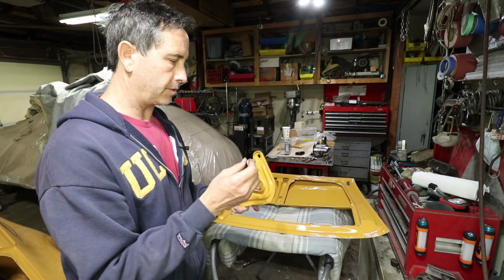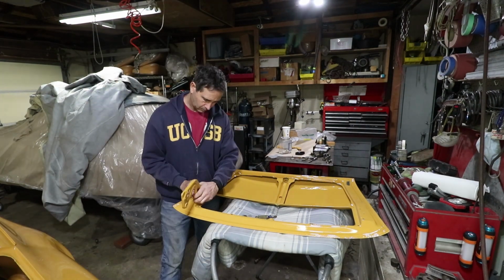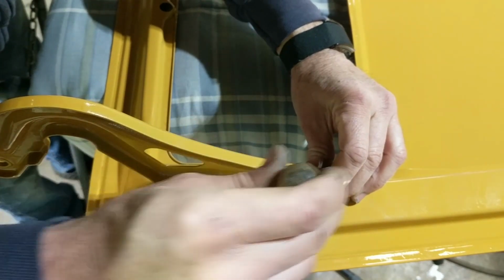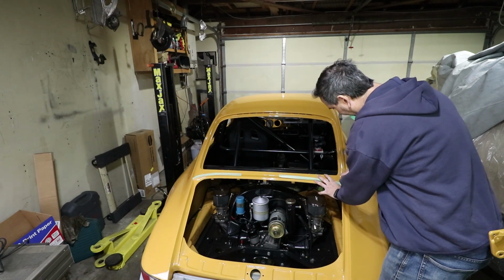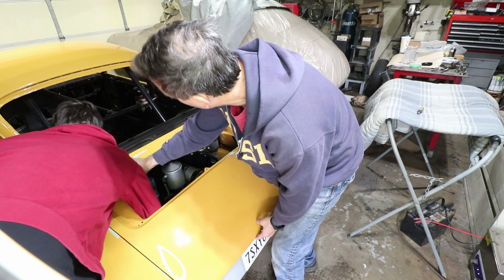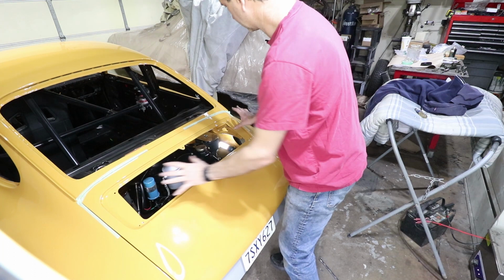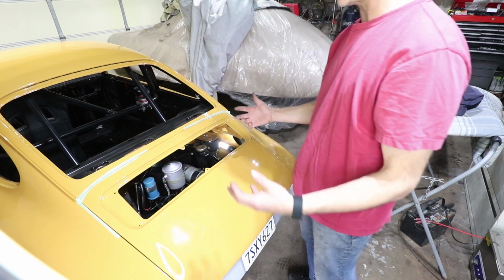There's some special shoulder bolts that go through here. So I just want to verify that with paint, they still go in and spin okay. Okay, you want to put the nut on? This way or? Yeah. That little blue thing is pointing to the outside. Looks pretty centered to me. Okay, I've got an extra shim on this side and I put some shims on this side too. It looks pretty level. This side might be a tad low.